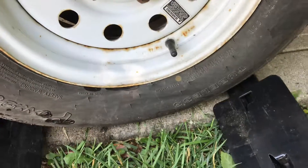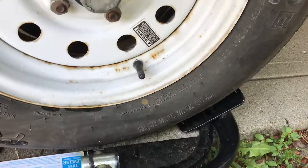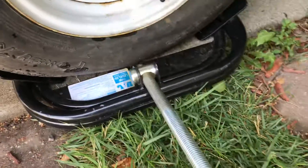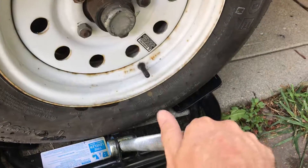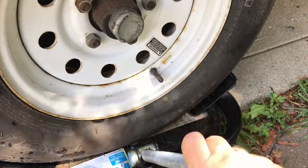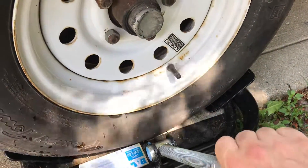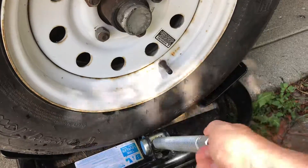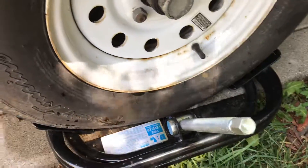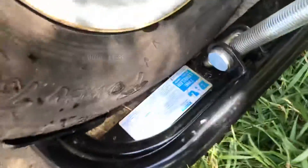Slide it under — this is the left tire, so the low side. It also works really well as a wheel chock. Normally you would put this in before you unhitch; I forgot, but it's safer to use it like a wheel chock. If you're low on one side at your campsite, put this in instead of a wheel chock and the camper will stay put.